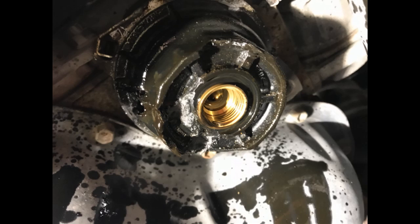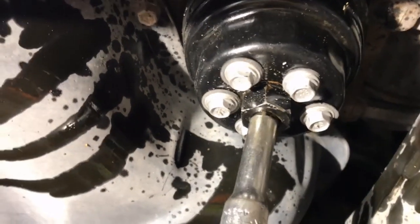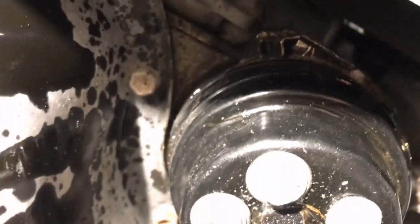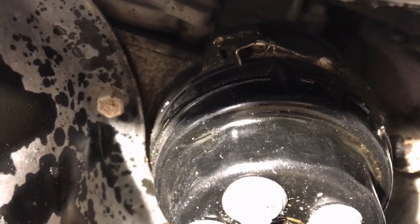I'm going to show you how I got it off of there and how easy it is to get a new one. This is an oil cap on a 2013 Toyota Camry. The way these are supposed to be tightened on is very loosely, and then you bend this metal tab over onto one of the teeth so it can't come back off. Some people don't know this tab is here, so when they go to take it off it won't turn and they chip the teeth.